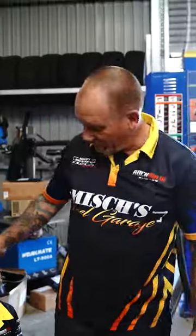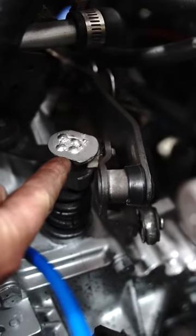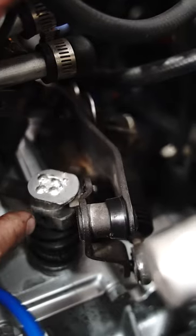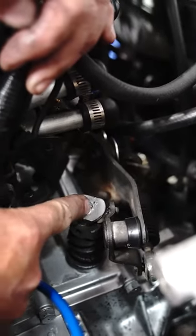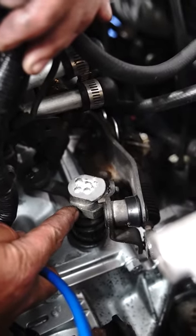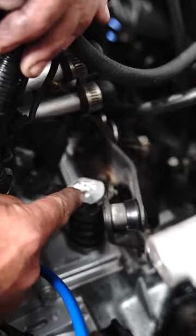Here's my little assistant — are you ready to help me? Let's hop in the car. You can see how you've got the cables moving here, you've got your selector up the top here moving. So what we're going to do is look for excessive wear in these bushes here. Normally, if that bush is really worn, you'll actually see a lot of cable movement and not much movement in the actual shaft itself — that's your side-to-side movement. The next movement we're going to check is your backwards and forwards motion. This next movement is actually pushing the gear shifter in your second or third motion, just wobbling it while it's actually there. When you get a worn one, you can see I've got a couple of little tack welds on the top here. The reason for that is that the actual pin that goes through the top of the selector wears. Sometimes you can't actually get them out without having to destroy them, so what we do is put a couple of little tack welds on the top, which then holds all that in place and reduces that slop.